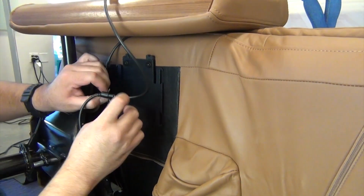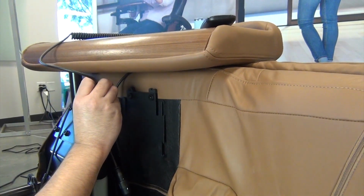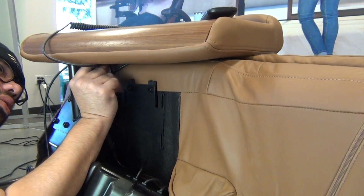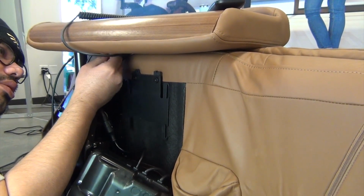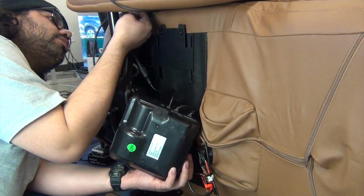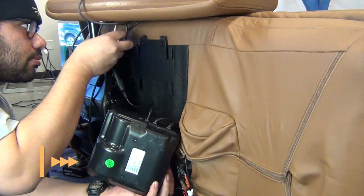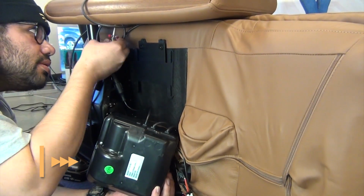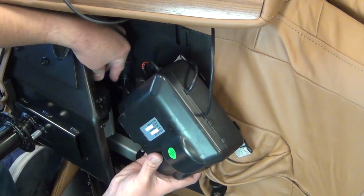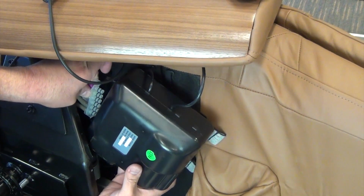Now, install the white cable guide onto the remote cable guide screw, then secure the screw to the underside of the armrest. Next, make sure the remote cable is tucked behind the air hose bank, then connect the air hose bank to the control box, with the pink hose on top. Be sure you hear the tabs on each end snap as they lock into place.